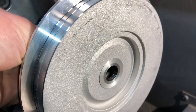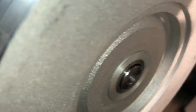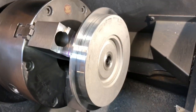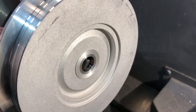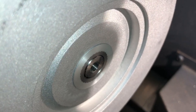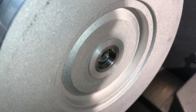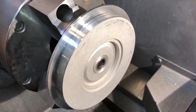This is an H1C plate and this is an H1C collar. You can see how the collar sticks out like it's supposed to. Now if we want to upgrade this to an HX40 series, we're going to need an HX40 collar to bring the compressor wheel back into the pocket. When the HX collar is inserted, there's not enough of the collar extruded from the plate for it to be able to touch the compressor wheel. So you're going to machine that part back to allow us to use the HX40 collar and compressor wheel to upgrade the H1C.